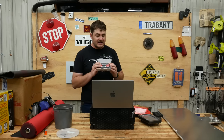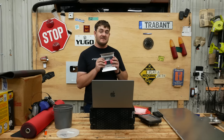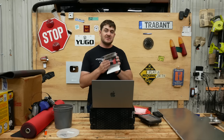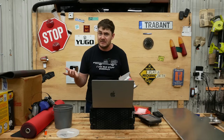There is one downside: these aren't actually standalone BMS units. The AEM VCU is what does all the computing — these are just hardware pieces, so they have to be used with an AEM VCU. That is the only downside, but I'm already using all AEM components, so this is great.